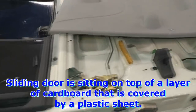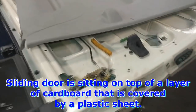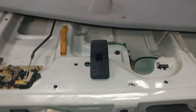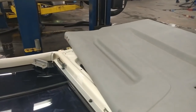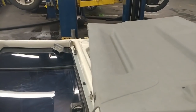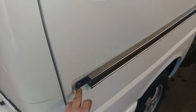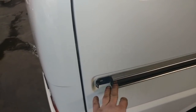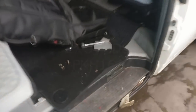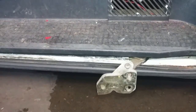When you want to work on the central locking motor on the Eurovans — it's for the sliding door — it's easier if you take the whole door out and work on it on the table. All you have to do is remove three mounting bolts for the bottom of the slider rail; the top just hooks in. On the other side, remove the stop in the rail, then slide the whole assembly out. There's a little plastic cover with a Phillips screw — take that off, slide the rail out, and the whole door comes out. Disconnect the three bolts at the front and you can remove the whole sliding door.